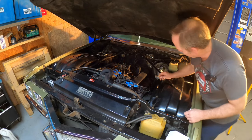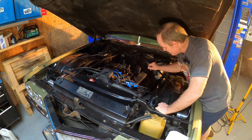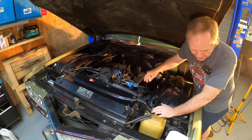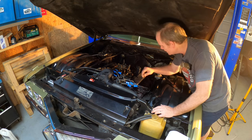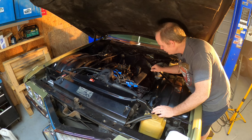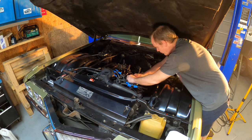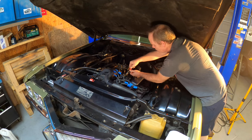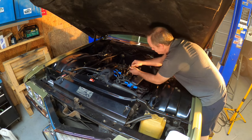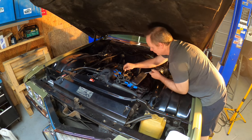Let's get it on the car. The breather is off and I've got painters tape out and numbered all of my plug wires. The firing order on one of these motors is 1-5-6-3-4-2-7-8. The battery has been disconnected. We're going to replace the coil as well, so let's go ahead and disconnect the wire going to the little filter capacitor.